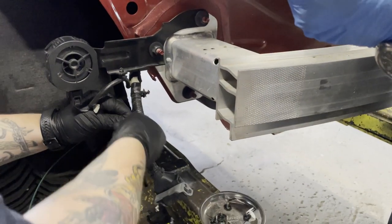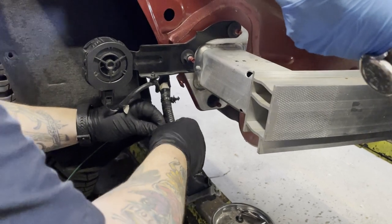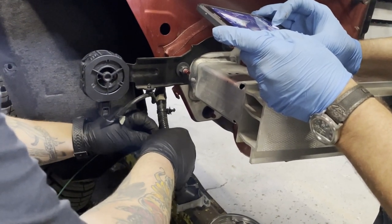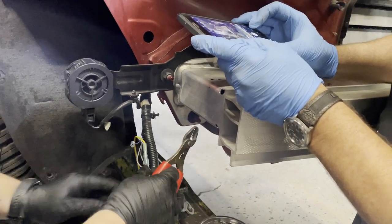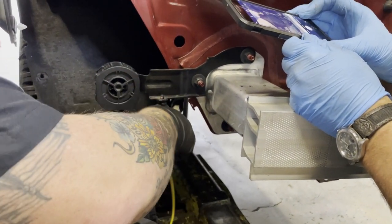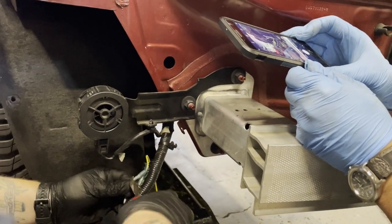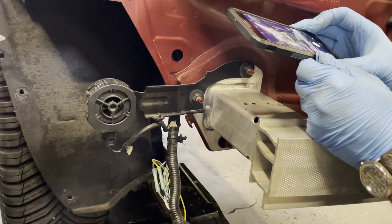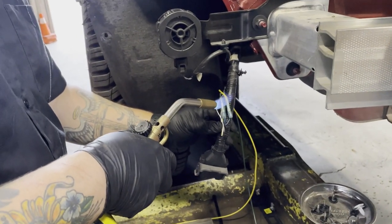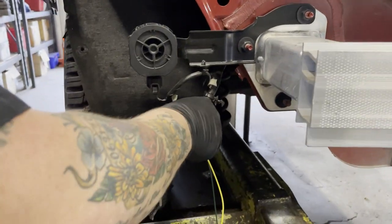Leave the brown wire at its full length until connecting it to the harness behind the passenger side tail light. Strip the end of the white wire of the double conductor wire. Use a heat source on all splice connectors used on the exterior of the vehicle. Secure your wiring and tubing with electrical tape.